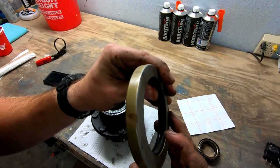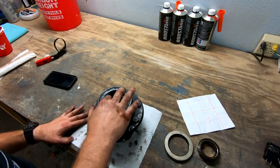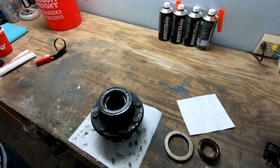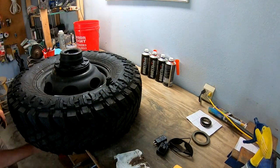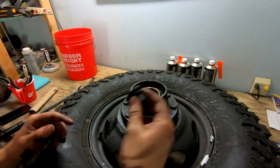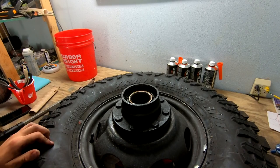The orientation: you can see these are angled a little bit. The old one has them angled going in, so we're going to have ours angled going in as well — it's going to be a perfect fit. For removing the old seal, I saw a trick on another video: take a couple of spare lug nuts, pop the hub into the old wheel, and that's a perfect way to hold it from flying around. Seal's out.